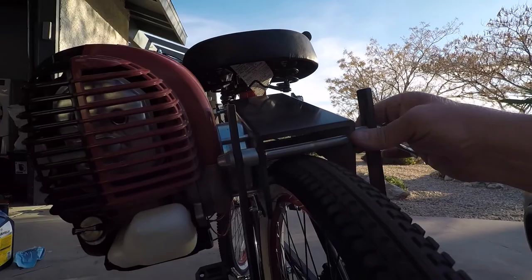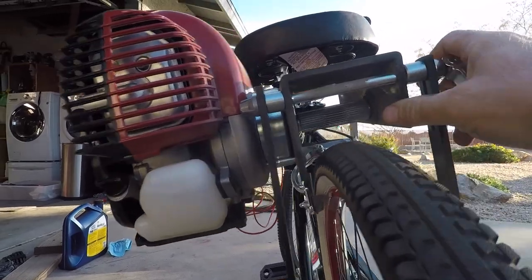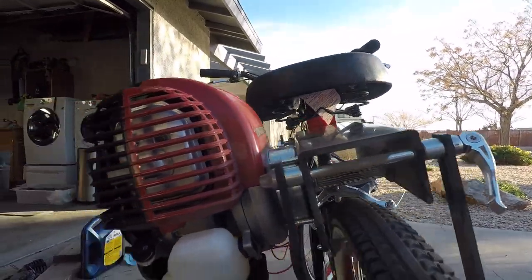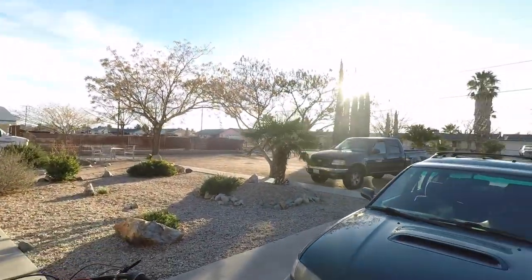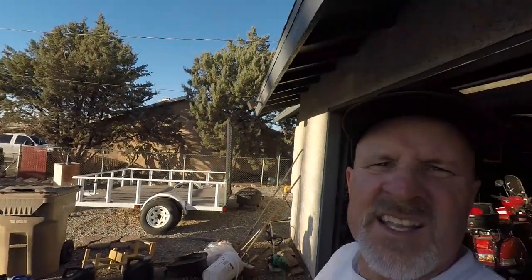We're done with the build and I'm gonna give it a thumbs up. It started out a little slow because on these Chinese engines the centrifugal clutch is kind of uneven, so it takes a minute to wear in. It's not slipping as much now and has better pickup. I used the one-inch roller which gives a little more power for heavier riders. I'll lift the friction drive up off the bike so you can see that roller — it's a centrifugal clutch. It's a great little project, a lot more practical than the last bike we built. Very smooth running, does about 20 miles an hour.